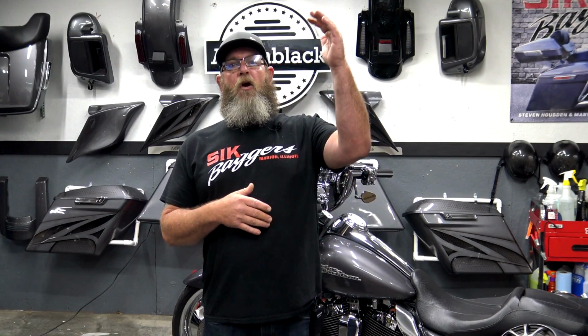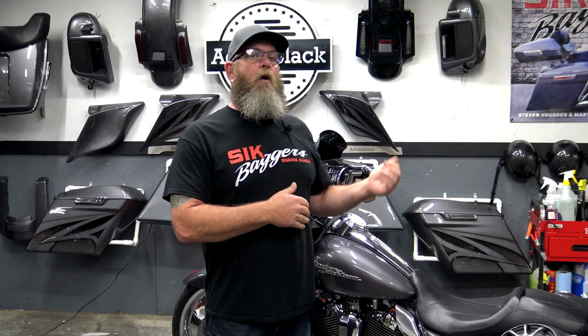Didn't really cross my mind until we got everything buttoned up and I went in to make sure everything was working properly, but I had all of these codes. So I knew right then those were historic codes. Now on the odometer, it's not going to tell you if it's a current or historic code. So that's something that you are going to have to diagnose yourself or take it into Harley and let them do it. Now, if we would have rode the bike and it would have threw more codes after we cleared them, then we know that that's a current DTC.